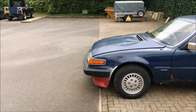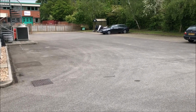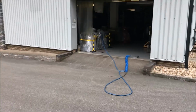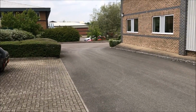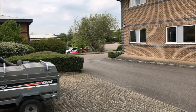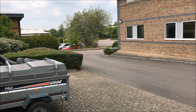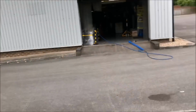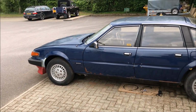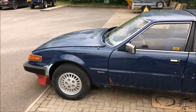I'm lucky because I have a lot of space and it's a slow revving engine, so even in first, once running, I hopefully won't be barreling along out of control. So I'm going to go down here around to the right, then there's a big open bit of tarmac down there, so I probably won't be filming this. I might try and do a little bit while I'm driving around one-handed, but we shall see. But yeah, gonna get it started up, warmed up, and then trundle around there, foot on the clutch, pulsing the accelerator pedal, and see if it'll just unstick.